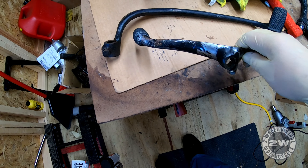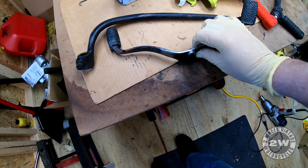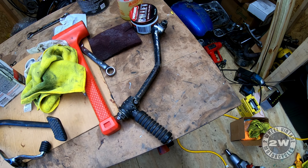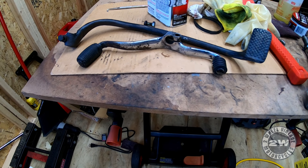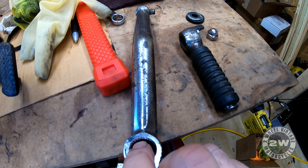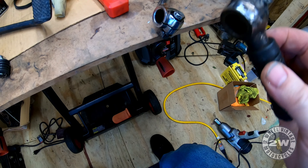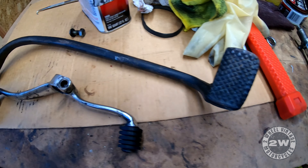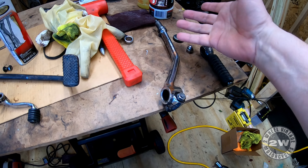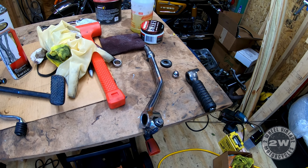The brake pedal is getting ready for paint. The shifter lever is not supposed to be painted - I got some of it off and I'll work on that. The kickstart lever is not supposed to be painted either. Maybe the chrome is really bad underneath - that's why they did it. I'm going to try to get the paint off and take a look. Yeah, that must have been the issue - just too much rust, they must have painted it so it wouldn't look so bad. This is all beat to crap too. I'll paint up the brake pedal. The shifter has a detent or spring that's supposed to be there - it just flops around and doesn't hold, so I'll have to look at that.